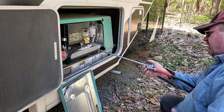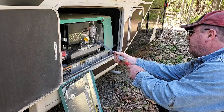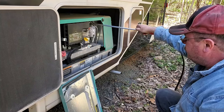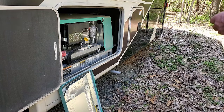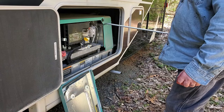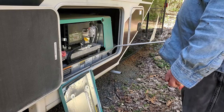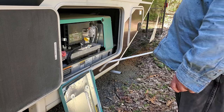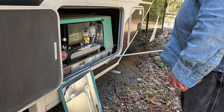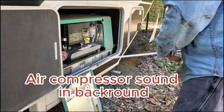I'm not sure how this comes out but I know it's a project — there's all kinds of wires and you have to put a lift under it to drop it down. I'm going to try not to do that. So I got an air hose and a long wand and I'm going to blow in the back and the top of the engine and around the sides. I already saw some acorns laying in here. There's a bunch of acorns. When I started it up there was little pieces of white dust blowing out, so I know there's stuff in there. There's even a little bit of paper laying down here — it looks like sawdust.